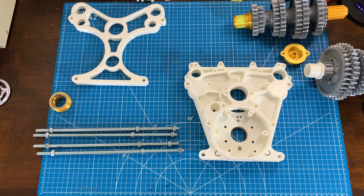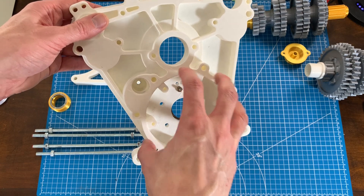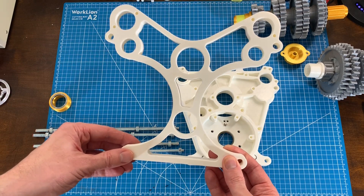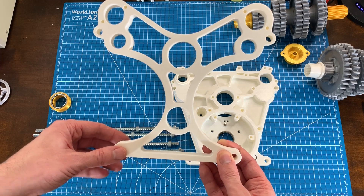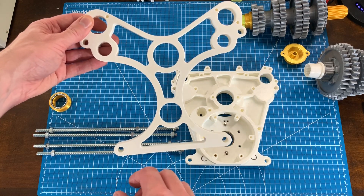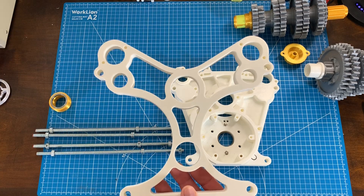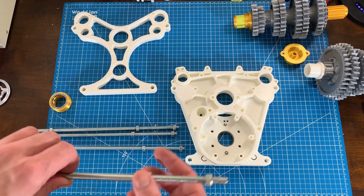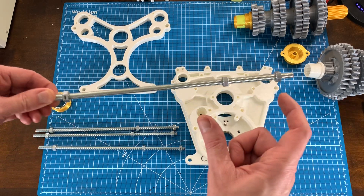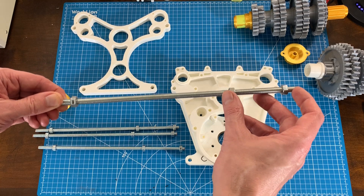The frame is pretty straightforward. This is the actual input plate, where the clutch and clutch cover will be mounted, and the drive goes through that bearing through the lay shaft. This mount is something I believe F1 teams use just for maintenance and building up the transmission — from what I can tell, these holes are actually integrated into the transmission's case itself. I'm using it for the model so the transmission can stand up and spin. The part that holds each end of the transmission together is just some 8mm threaded rod. Right now I've got two nuts on each end so I can dial in the ideal spacing and set the free play on the shafts.